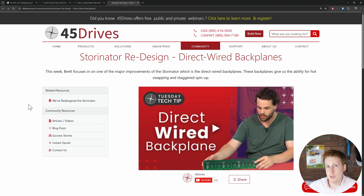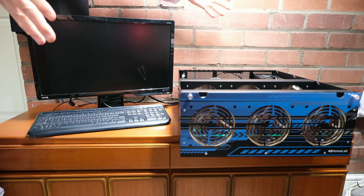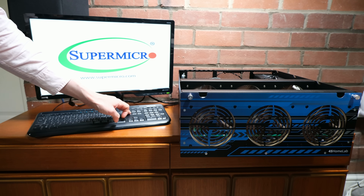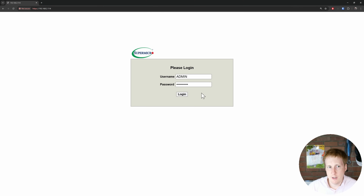Now let's jump straight over to me booting this up for the first time. This isn't an editing trick — this is literally me powering it on for the first time. I've simply got a monitor attached and an Ethernet cable plugged into the IPMI port. Once that's booted up, we're going to log in first time into the Supermicro IPMI and hopefully access Houston for the first time. For the HL15, the power button is on the top left of the reverse of the case. On that first device boot, I like to go into the BIOS to make sure hardware is registered and possibly run a memory test. Grabbing the password off the side of the machine, hopefully we can log in to the IPMI.